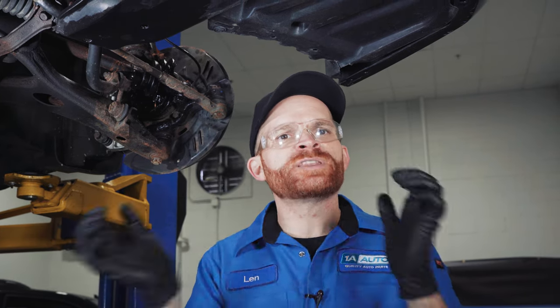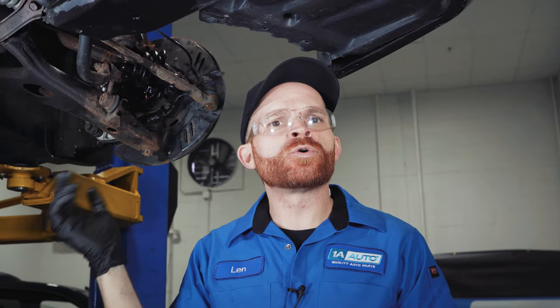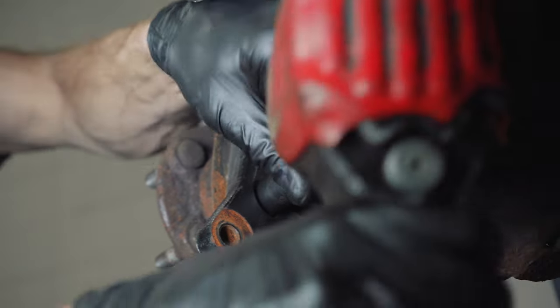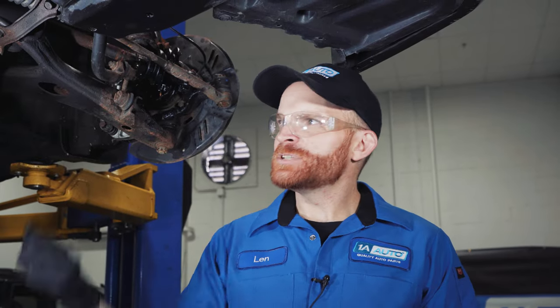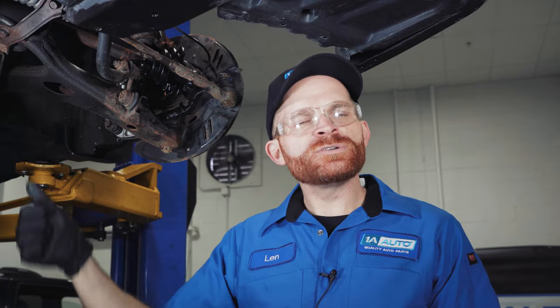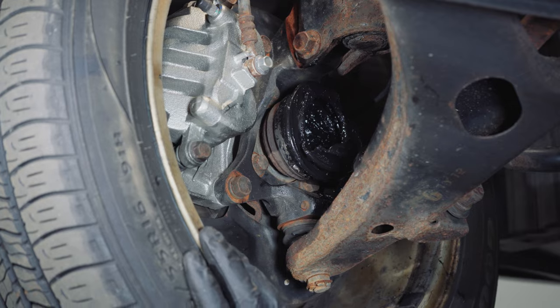On most passenger vehicles, what you're going to find is a sealed wheel bearing. Back in the old days, they had adjustable wheel bearings — you would take everything apart, clean those bearings, give them a close inspection, repack them with grease, and put everything back together, making adjustments so you don't have any bearing movement. Passenger vehicles nowadays have a sealed bearing, whether it's a pressed-in bearing or even a bolt-on. This one in particular has a bolt-on wheel bearing. Generally for those, you would remove the axle nut, break the axle free, and remove the bolts holding the wheel bearing to the knuckle. Once you do that, the wheel bearing will pop right off — probably not. At that point you might try using a hammer and give it a couple of bonks, but when you do that you can cause some serious internal damage to the bearing. You might not feel it now, but after driving down the road, that movement is going to continuously get worse and worse. You're going to start hearing a noise and eventually you'll be able to shake your wheel around like what we had here.